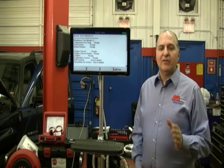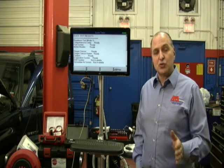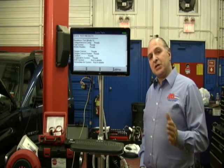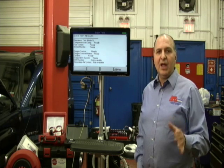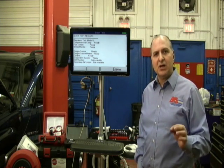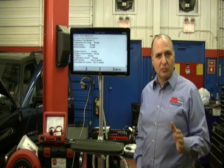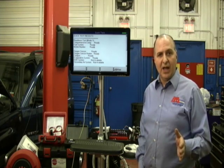No substituted values means: if there was a problem with your MAP sensor or your coolant sensor had it open — meaning you were reading five volts — and you were in Chrysler enhanced or Jeep enhanced, you may see a substituted value. It may plug in that the temperature is 189 degrees, so you would not know to look for a problem with an open coolant sensor. In generic OBD2, what comes up is going to tell us what is real. There is one exception: if the vehicle had an air-fuel wide-range sensor — AF or WR — some scan tools don't record the PID correctly and you may see approximately 685 millivolts that won't seem to move. But the MAC tool we're using does a great job — it would show you if it was an air-fuel or wide-range sensor.